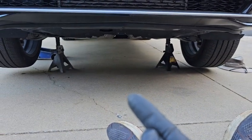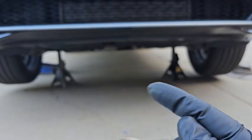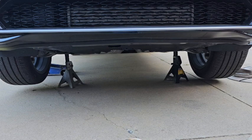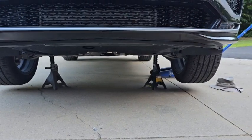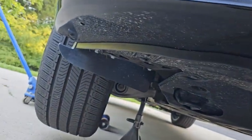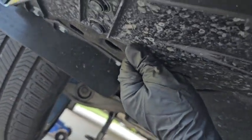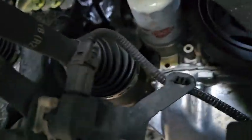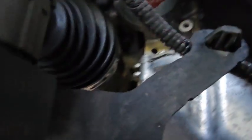The way I've got this jacked up, this side of the car is a little low — the drain plug is on that side more so than the other. It would really be beneficial if the car was level or leaning that way slightly, so I'm going to move the jack over and put a little bit of lift on the driver's side. Now we're at the passenger side, the right side of the car.